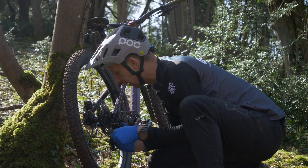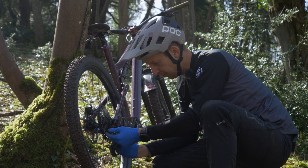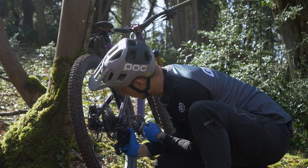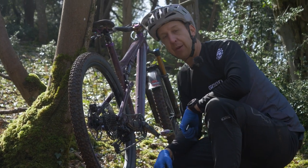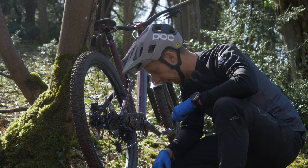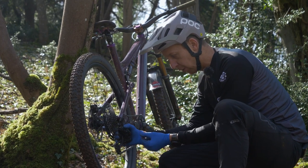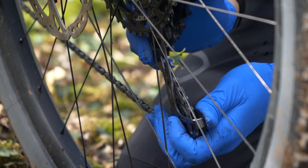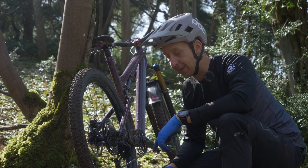Although the cage is still a bit bent, I can actually get those higher gears back. I'm nervous about the lowest gear though, so I'm going to screw in the limit screw for that. The result is pretty pleasing — I can see daylight through the cage and get some movement on the derailleur. It was a pretty dramatic bend, so there was a real risk of snapping the derailleur. You have to really support where you're bending it, which is why I chose to take this one off. By holding the actual body of the derailleur, you can get good pressure to move those lower cages.